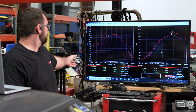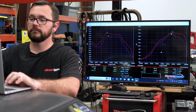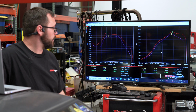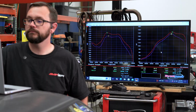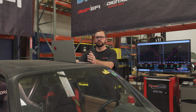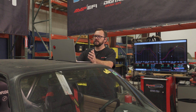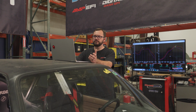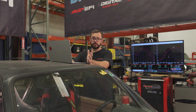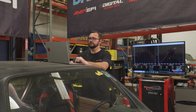It made 146 foot-pounds, and that RPM is 4,060. I'm going to use 4,100. Now, the MAP is going to be a little lower than 100 kPa. I'm going to leave it at 100 kPa because it was somewhere between 100 and 95. Stock manifold, really the stock manifold breathes very well on this engine for what it is.